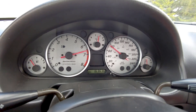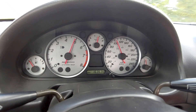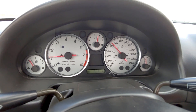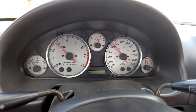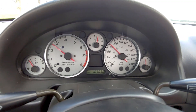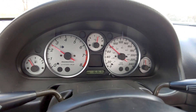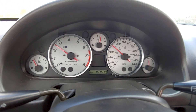Basically no turbo, almost no turbo. And at a hundred, there it is. So didn't throw any codes or any lights, but as you can tell, the car basically didn't hit boost. When this car is working properly, when you hit that 3500, the tach just goes. It launches right up until you do that next shift and drop it down. So the car feels incredibly slow. It takes a lot of the fun out of it. You bought a Mazda Speed turbo for the turbo, and it's essentially not working. So we've got to fix this.